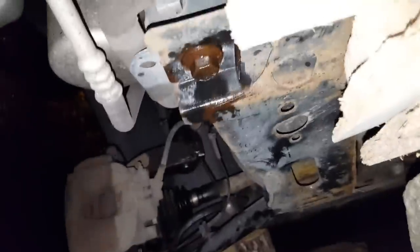So guys, before you remove these 18mm bolts, put some sort of support under the radiator. You will see these bushings. There are only two places where they are holding it, because the radiator is not holding anywhere else, only on this. So, just so you know, later on I think I will just remove this one by one, starting with one side and then moving to the other side. We'll see how it goes, but now I'll remove this bolt too and we'll see where it will go.